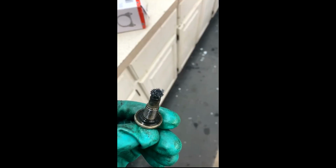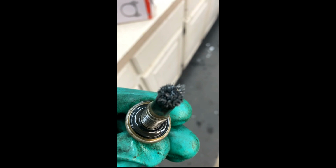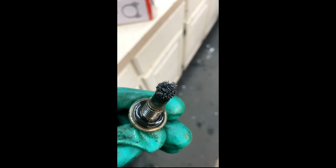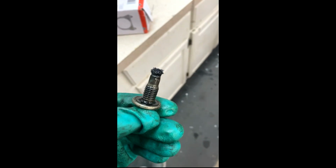You can see all that metal debris on the bolt. So, I'm going to take a magnet once the oil's done draining and see what all I can get. But all that metal should now have been falling down there, and I jacked the truck up some so it'd angle a lot better, and we'll just keep after it. Here's a better picture in the garage light. Yeah, look at all that. Wow. Good thing for magnetic oil pan bolts.